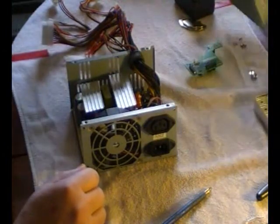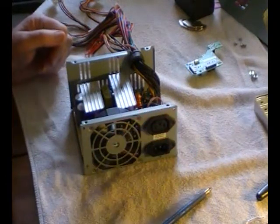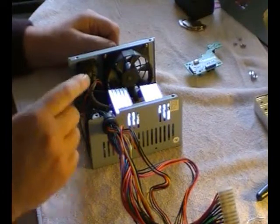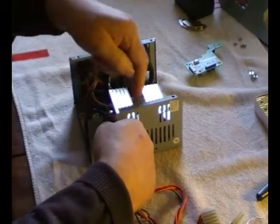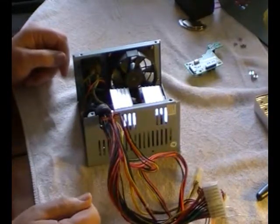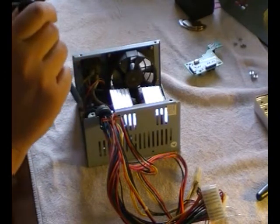Now again, at this point, keep your fingers away from the printed circuit board. You need a pair of insulated pliers, long nose, short nose, it doesn't matter which. Now, in order to get the cables out, the way I do it is I grab hold of the bundle like this, and keeping my fingers well away from the heat sinks, I roll it round and it slides out quite nicely. I've taken the fixing screws off to speed things up a bit for you. So I'm going to now take the last screw out of the printed circuit board mounting.